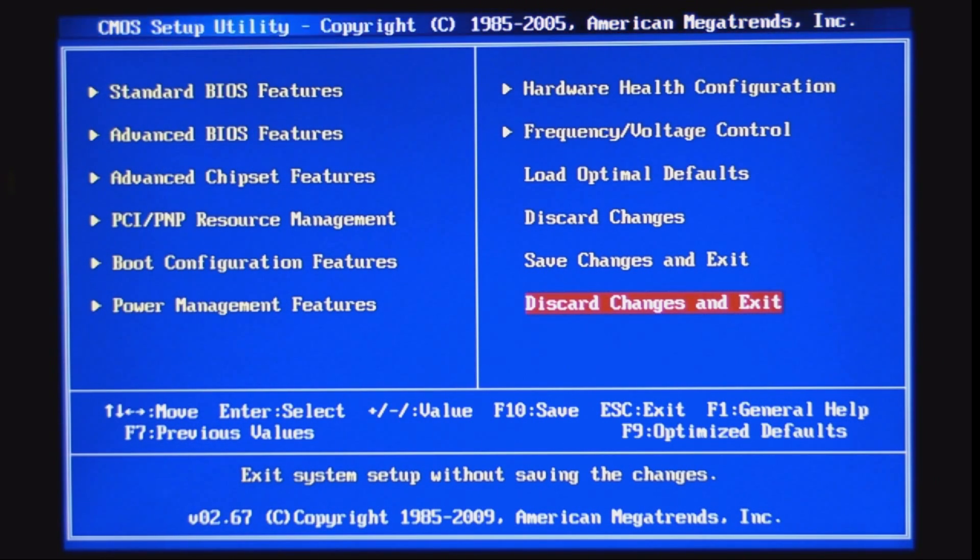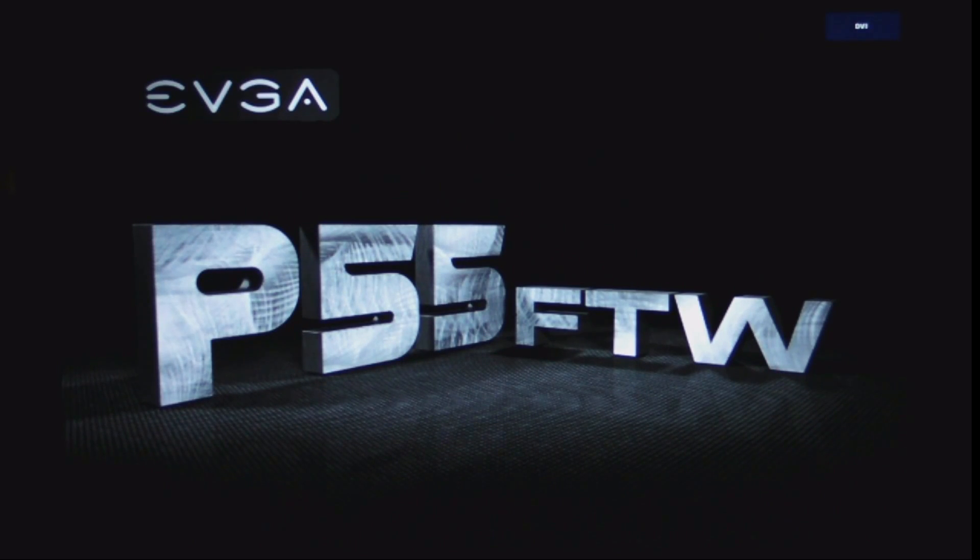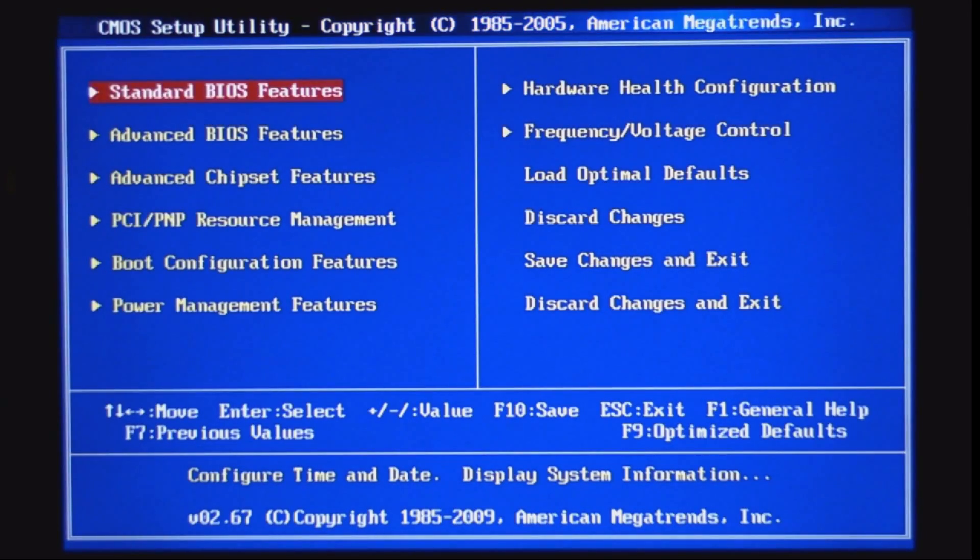You're probably wondering how to get into the BIOS. It's pretty simple — you need to restart your computer. After the black screen it's going to POST, and when it posts you'll see some text on screen. At that point, click the Delete button and it will bring you to the blue BIOS screen.